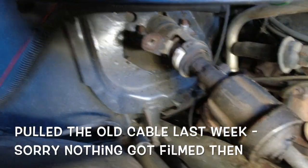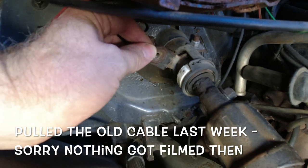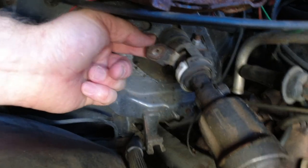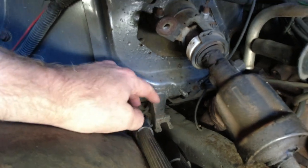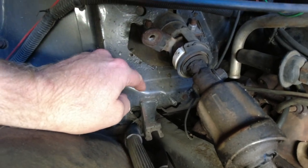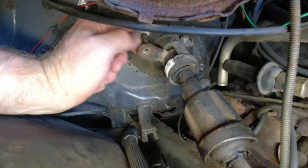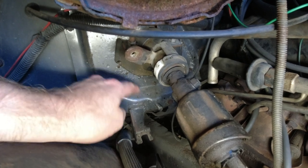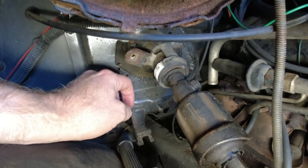Down on the steering column here, there's this little lever here. I actually bent this, so this cable holds into this bracket. Now on the left-hand drive models, this is all a linkage that goes straight to the trans, but because of the conversion we've got this cable. So I had to straighten this back up, and we'll bolt this cable back in, adjust it up here, then bolt in the transmission.